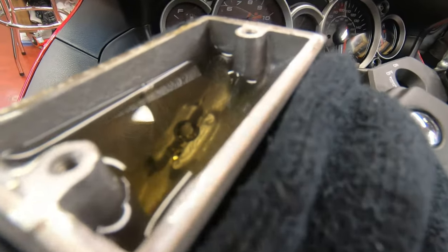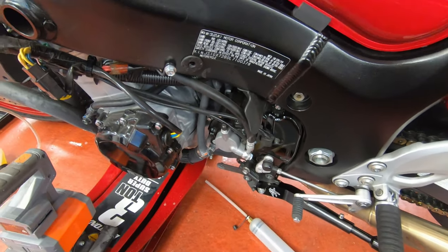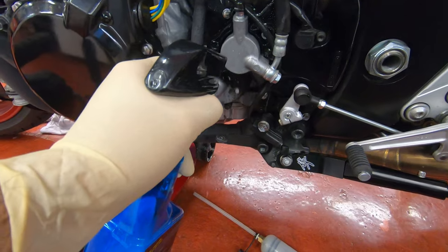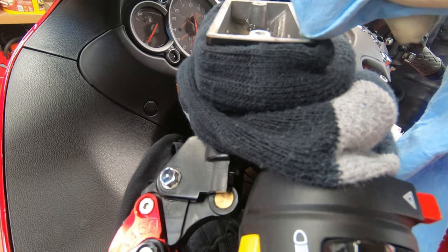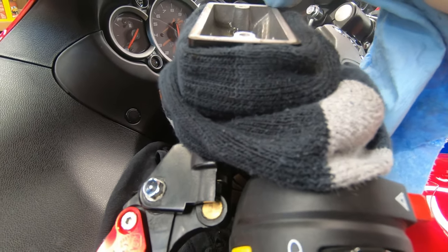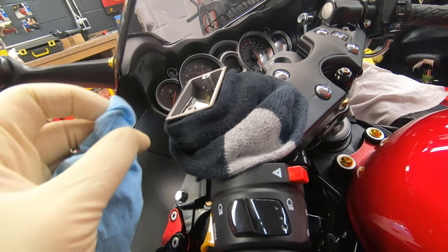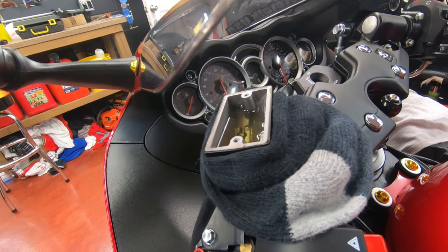The clutch is finally clean — I pumped out more fluid from the bleeder and it came out nice and clear. Rinse off around the bleeder again. Now I'm cleaning up the reservoir surface really carefully without dropping anything in there. It's amazing how dirty that surface is — it might actually be wiser to wipe it first and then do the bleed job. If anything falls in, you can suck it out with the syringe since you're suctioning fluid out anyway.